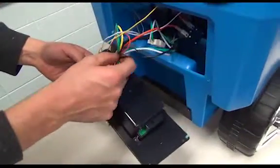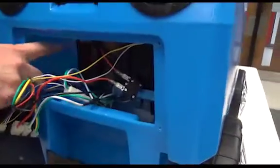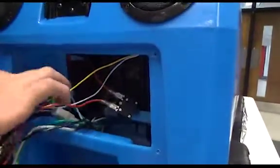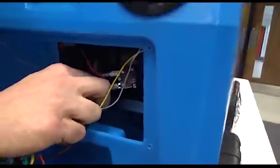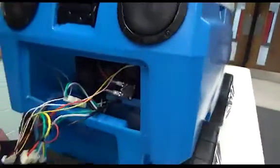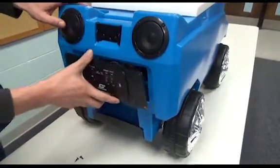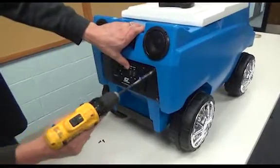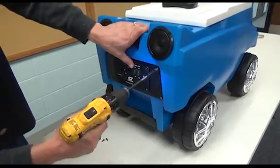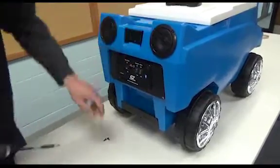You're going to follow the red and black wires all the way to the battery. The red wire goes up and plugs in there, and the black wire comes down to the bottom and plugs in there. Go ahead and make sure they're tight — give them a little tug. Those are tight. Sometimes in shipping they rattle loose, or if the unit gets dropped, because shipping can be a little rough. So you're going to have these problems.